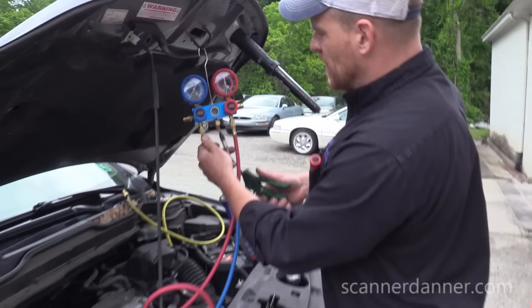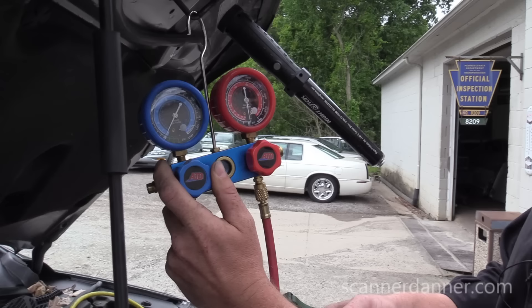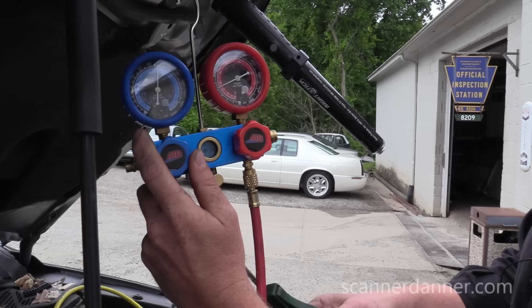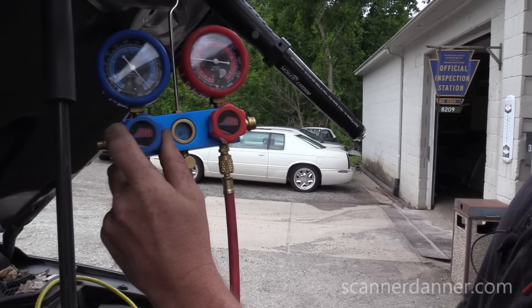Going with my air nozzle here. The gauge pressures aren't really critical, but I'm opening my low side gauge and putting air in right now. You can watch the high side gauge increasing — I'm giving it whatever the shop has. There's 125... that's 150. And then I shut the valve. So right now we're looking at 150 pounds of pressure in the system. Both valves are closed.